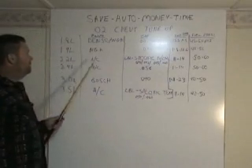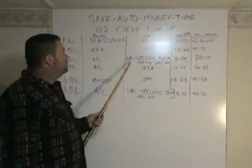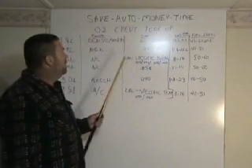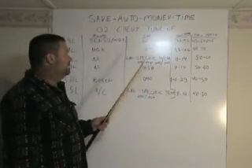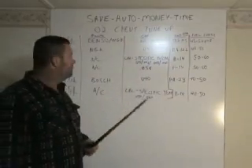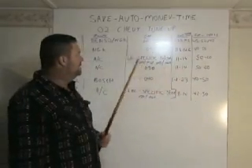On the 2.2 liter, it takes an AC type plug. The spark plug gap is specific to your car — you need to look at the label on your car for specifics. It will tell you whether it's 40, 42, 45, or 60 thousandths, depending on what type of car you have. They evidently changed and put different spark plug gaps specific to those cars even though they had a 2.2 in them, so check the label. The injector ohms can be measured between 11 and 14. The fuel pressure is 50 to 60 psi.